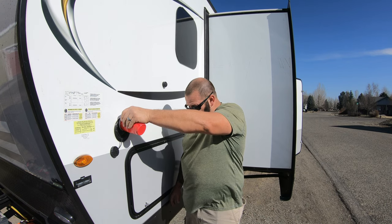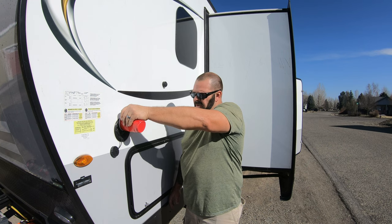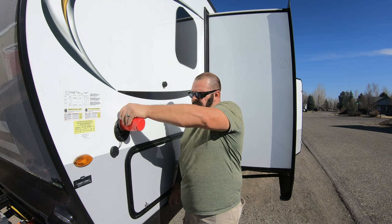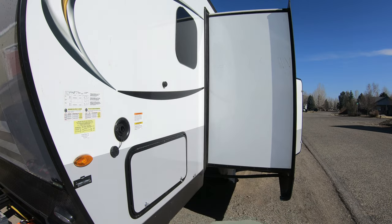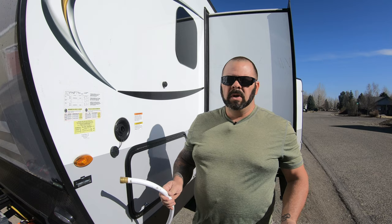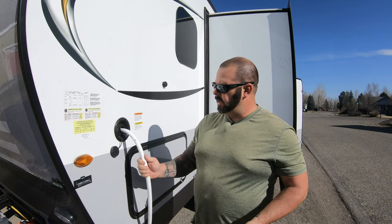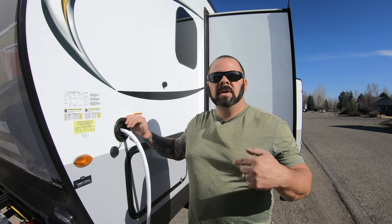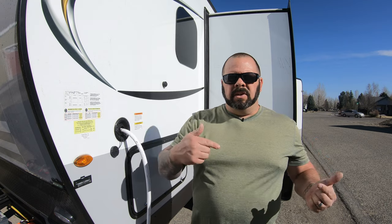I'm taking my time because it's trying to come back out the inlet. You probably can't see that on camera, but as I'm pouring it in, it's wanting to come back out. So I'm definitely just taking my time — I don't want to drip it all over the side of the camper. We just empty this quarter of a cup in there and that's all gone. Now we're going to put water in it and fill it up to right around a quarter of a tank. I've got my nice white bacterial-free hose — whenever you fill up your fresh water on your camper, you don't want to use the regular hose from your house because that gets a lot of bacteria built up. These hoses are special for RVs, and everything I use in today's video will be linked in the description below.